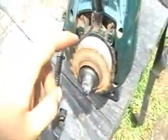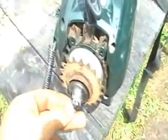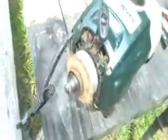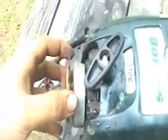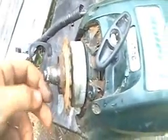I welded the sprocket onto the engine. It kind of just melted the part of the clutch that kind of stuck out there, and so I think it's good. I don't know, we'll find out when we start trying to drive it, if it just pops off. Yeah, if I have to, I could put a weld in between there. The problem is the welder's so strong, or I have it set on such a high setting, that it kind of turned that metal to crap fast. So this should work. Yeah, I just tested the engine to make sure it worked after being welded on. Yeah, it does.